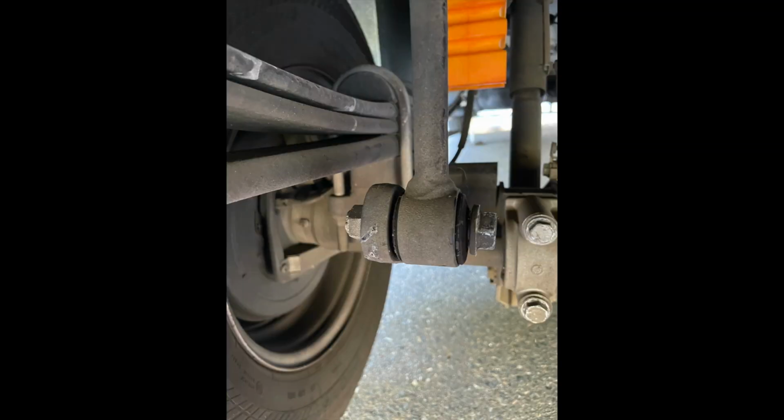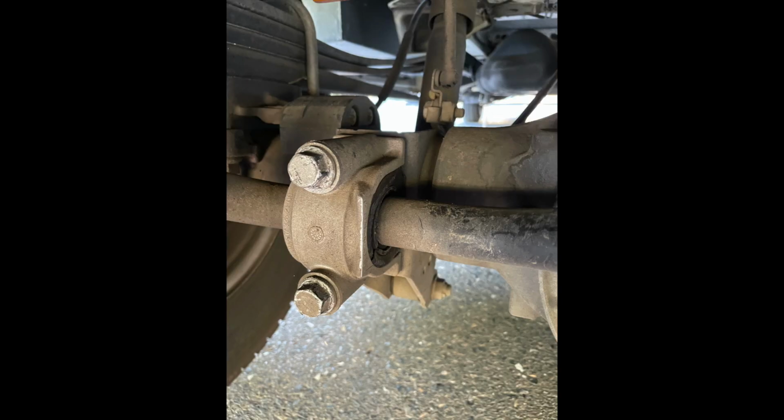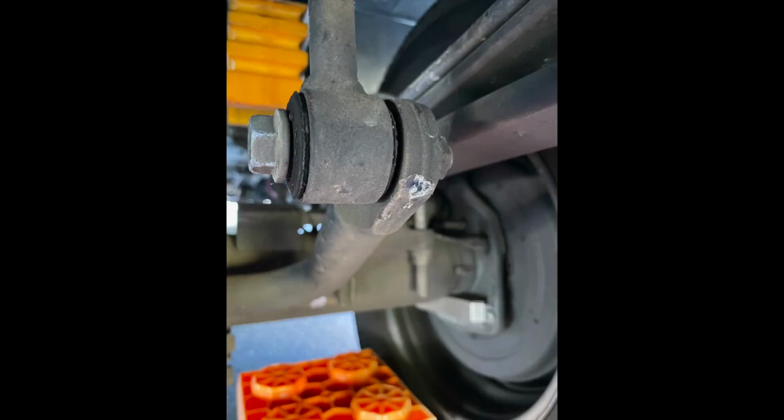I did jack up the back tires just enough to get off the ground using our leveling jacks, and then some supporting jacks on the side for safety. Then it was just a matter of going around and loosening all the bolts. I did them somewhat evenly across without doing one completely, and that way when the bar was loose it would come down evenly and not bend anything because of its weight.